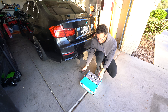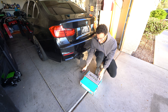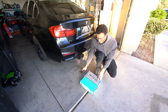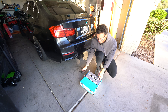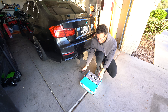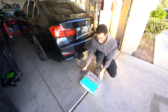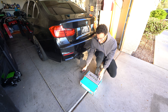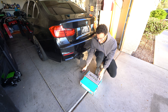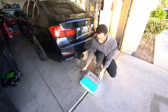We have the toe arm pretty much basically off. When I first started I tried to do a crazy long extension through here with a swivel socket on it and it just ripped the thing apart. It was definitely more of a pain than I was expecting but we got it done. On the inside part it's like a Torx T30 - it might be a T35 but I used a T30. I just got it cracked loose so there wasn't too much pressure on the Torx bit while cranking the bolt off. It seems kind of tough to pull the toe arm out without pulling the camber arm off as well - I'm just going to pull the camber arm off and do them both at the same time.